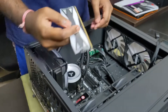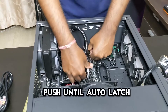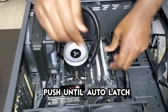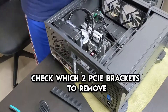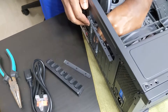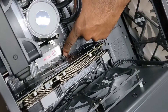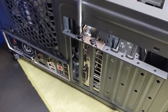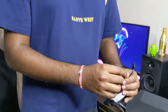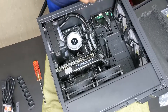There's a line that you can align the connectors to, so I'm just going to use that as a gauge. When you push the RAM in, the latches will automatically close back. Next is the GPU. I should open up two of the expansion slot covers to allow space for ventilation and the ports. This latch over here is the one that will catch on once you press it in. Screw in the GPU. We've got to connect the power — the GPU uses an eight-pin connector, so I'm just going to plug it in here. Now the GPU is connected.